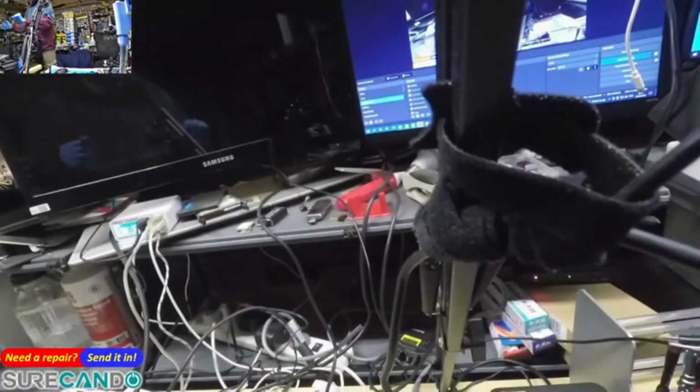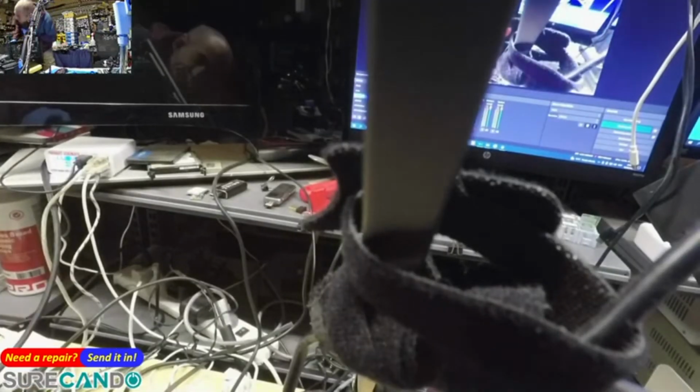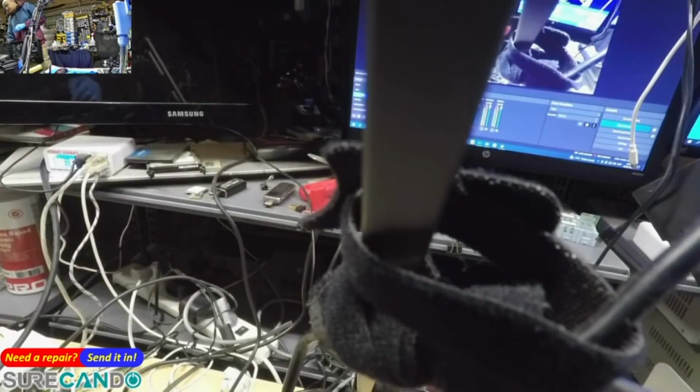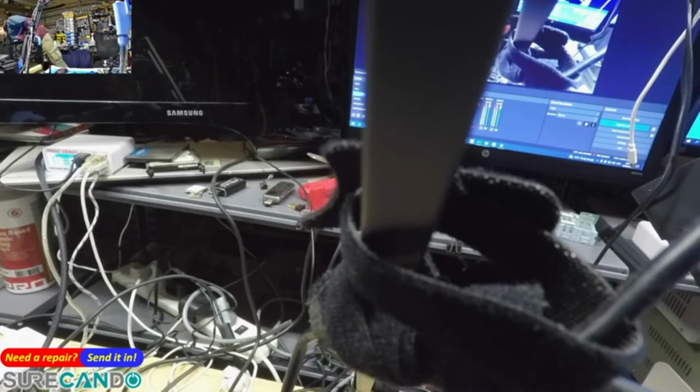That's definitely HDMI. Okay, GPU. They did test the GPU out, but to me it shows A0. A0 is a good code. Caps lock, num lock is functional. Let me disconnect HDMI and reconnect it. There's one more HDMI on the top. Okay, that's interesting.